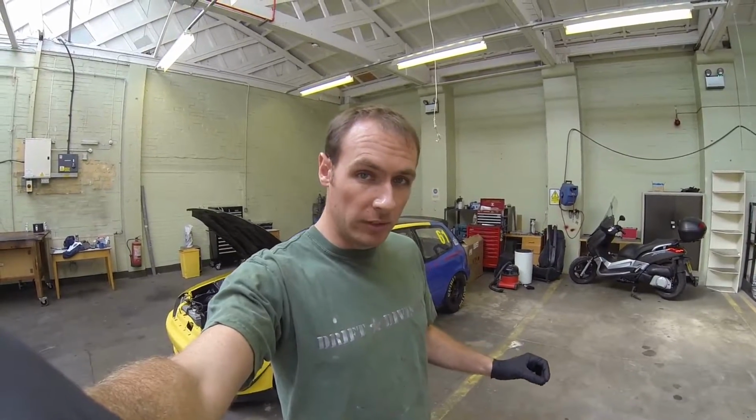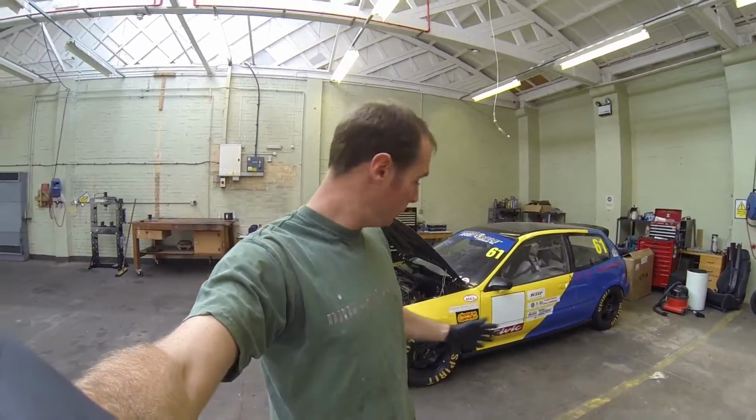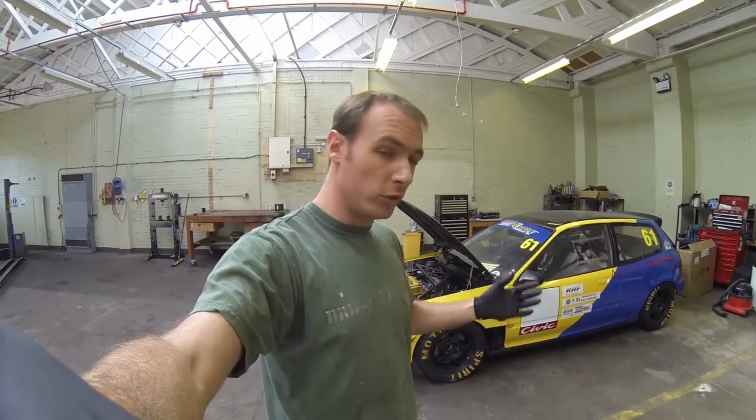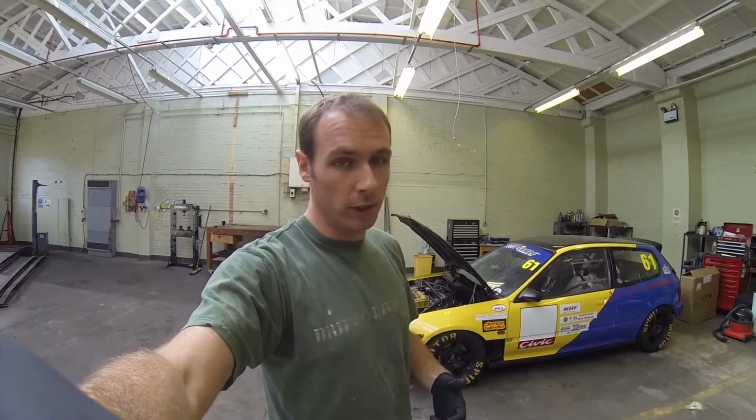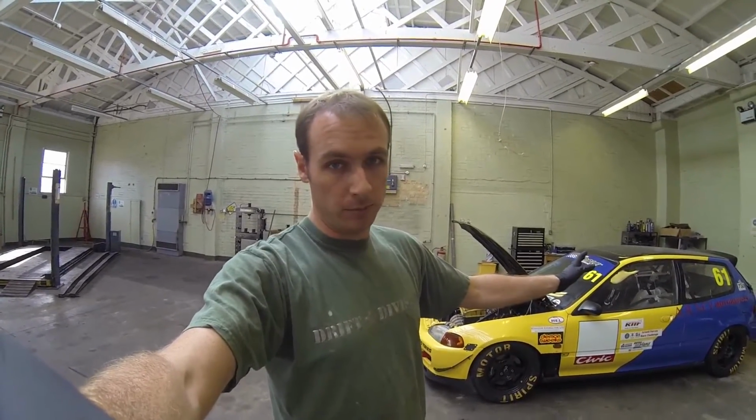Alright, I've got them small little jobs done that I wanted to get done, nothing too interesting, so don't worry about that. Okay, we're going to get on with corner weighting now. From what reading I've done into how to go about this job, you need to start at a good start state, and I'll go through that now. Basically the car, obviously you want it sort of at race weight, so I just put my front bumper back on. Unfortunately I've only got half a tank of fuel, which isn't quite realistic, but that should hopefully only affect front to back, because the fuel tank's central in the car, and it's obviously biased towards the rear.